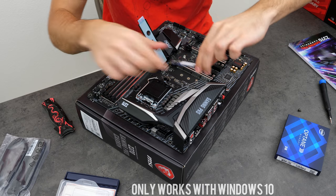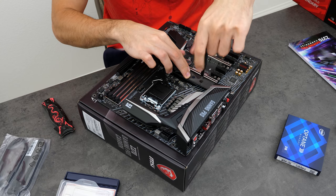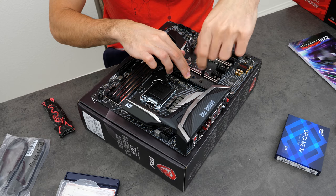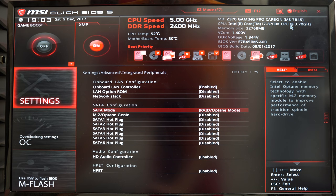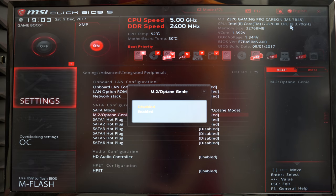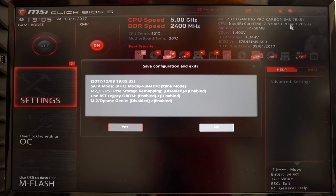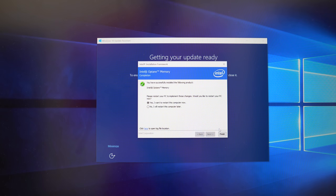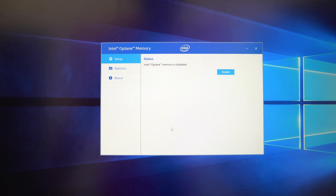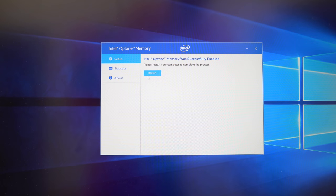To set it up, it's very simple, just insert the Optane memory module into your supported motherboard's M.2 slot and screw it in place. Afterwards, you will need to get into your BIOS and change up a few settings. You'll need to switch the SATA mode to Optane mode, as well as changing the following settings as well, whichever options are available to you. Next step is to download and install the Optane memory software, which I will link below. And once you are done with those, just open up the application, enable Optane memory, and restart your PC. It's as easy as that.